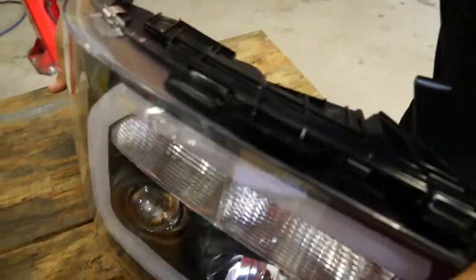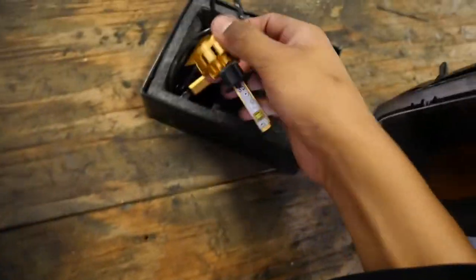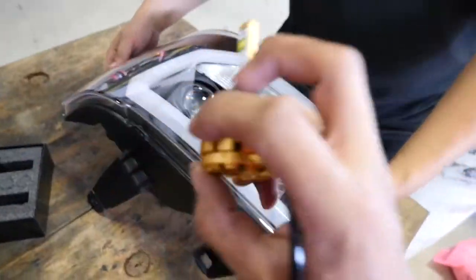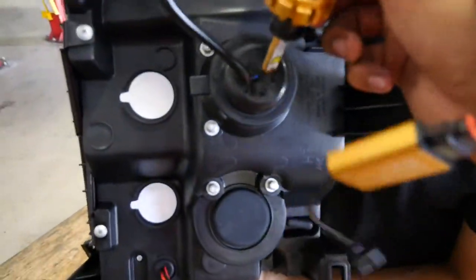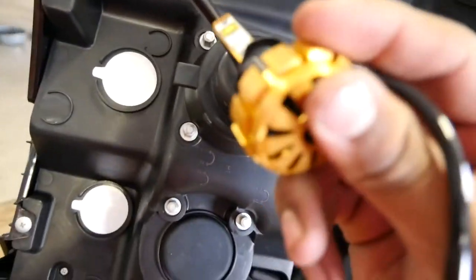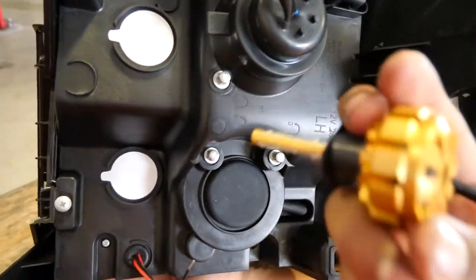So on these what I was saying is that these lights have a big housing with the fan on the back. So this won't fit in there - it won't close this little boot. So I'm going to show you how to cut it so that it can fit in there and still ventilate, that way it won't fog up your headlights and will keep them nicer for a longer time.